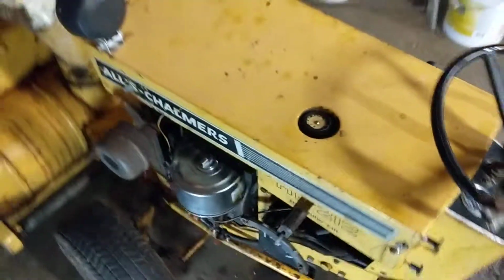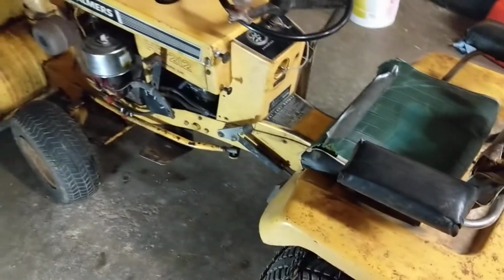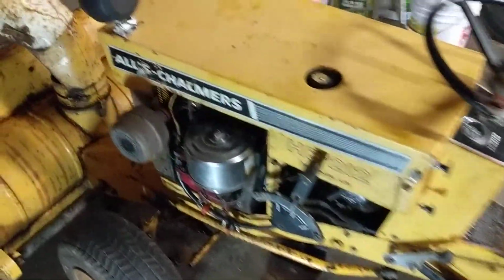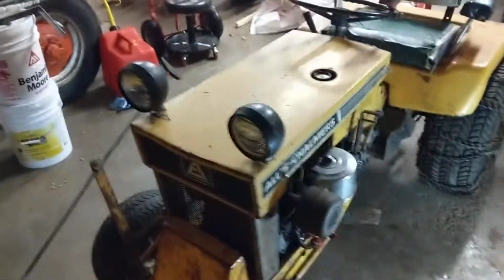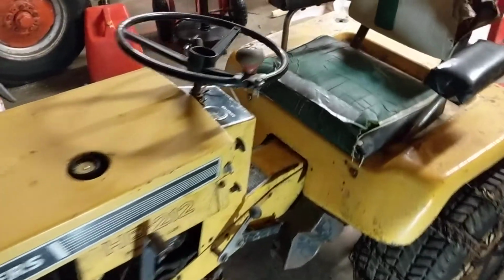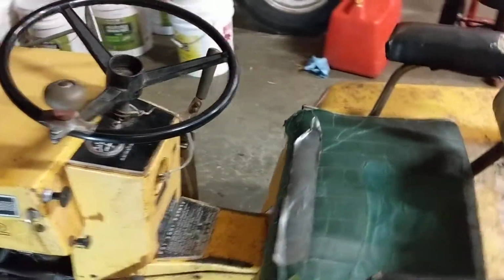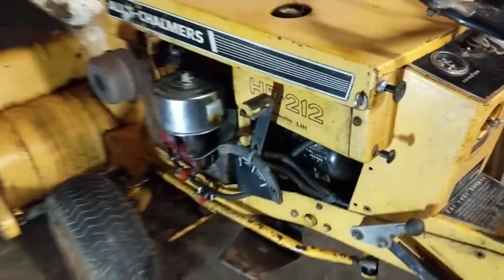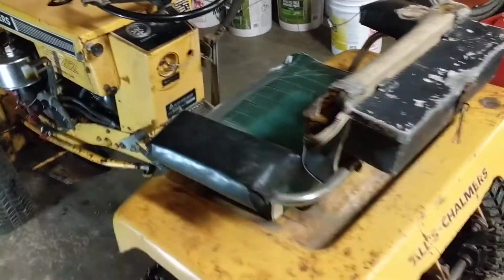Thought I'd make a little walk around video of my HB212. These were made from 1970 to 1972, I believe. Not sure what the year is on this one. But it is a 12 horse synchro balanced Briggs hydrostatic drive, which is nice for infinitely variable ground speed. It's got the optional hydro lift on it, which is pretty neat. Never had one of those before.